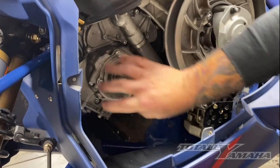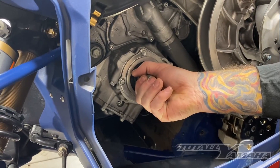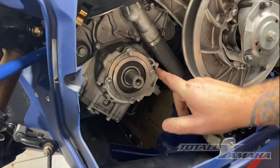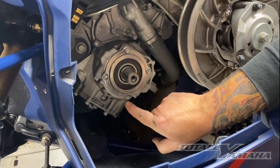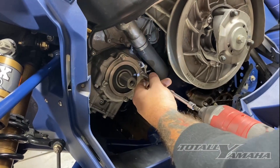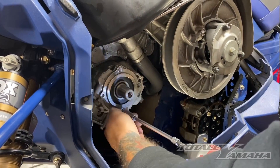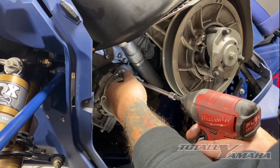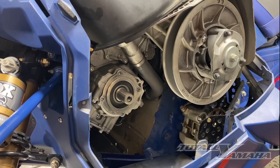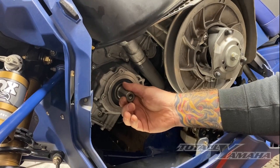Right here's the PTO. We're going to pull the PTO. I suggest warming up the machine — this has been warmed up until it comes up to full temp; I can feel the heat in the PTO. So we're going to pull off these 10 millimeter screws, set those on the side, and now we're going to pull this stub shaft out.